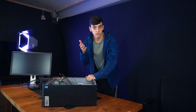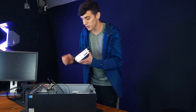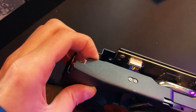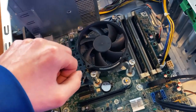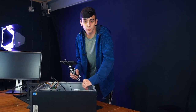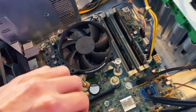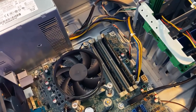Like any other gaming PC, we have to add a graphics card because you don't really want to game on integrated graphics. You might think, just grab a graphics card like this GTX 1070 and throw it in there. But any graphics card you try to slot in here will always bump into this, unless you have a weird gap behind the graphics card, which not many cards have. This one's too long anyway. You've got to find a shorter graphics card, which are hard to find right now when everything is expensive and pretty much sold out. And I don't know why they would put a USB 3 cable behind the graphics card slot — it makes it impossible to fit a bigger card and means you have to come back to them to buy a brand new system. There's also a problem with the right-angle connector — it's not something I'd feel comfortable reselling, because every time you turn it on it beeps saying there's no USB 3 connection.